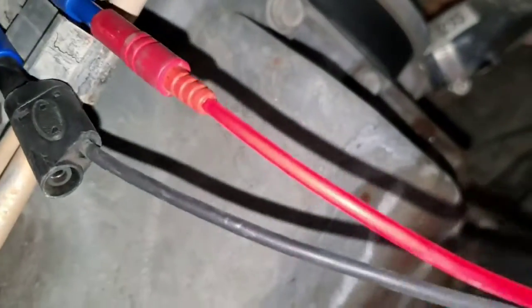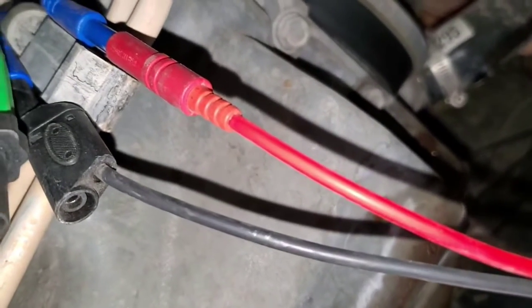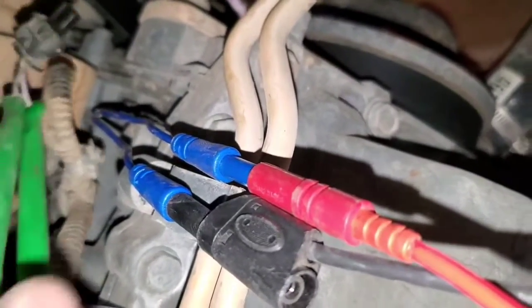And that's exactly what it was, because I sent my own power and ground to it through my multimeter measuring amps, and it quickly shot up to 12 amps as soon as I plugged it in. It shouldn't be near that much, so the oil pump in this instance is bad.